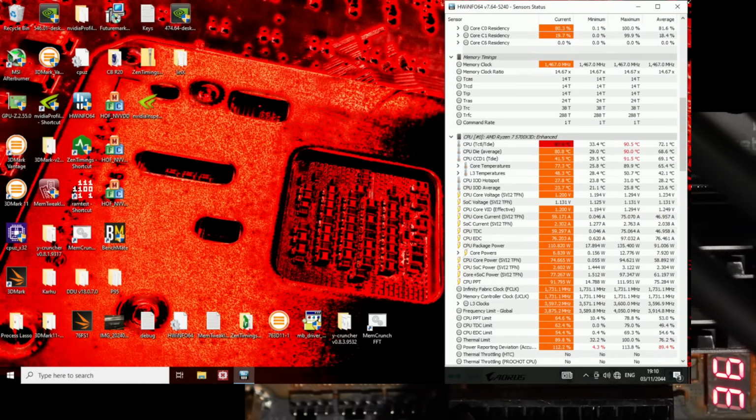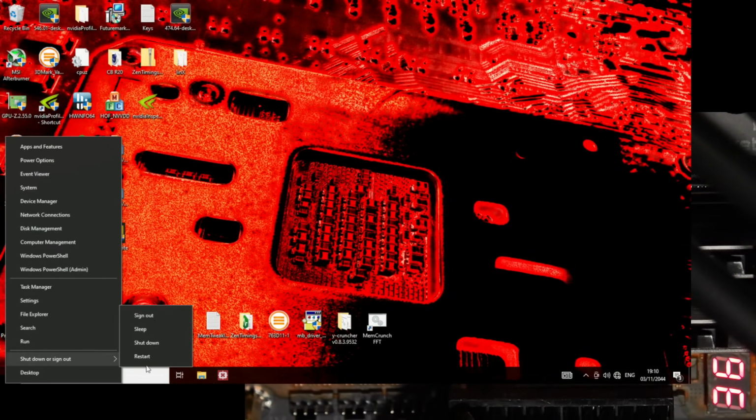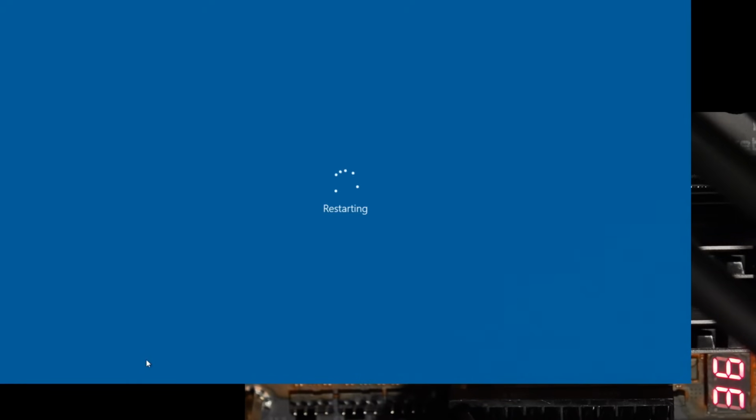But yeah, it just bugs me that this has to be so janky. At least on AM5, you do have ECLK, and the ECLK doesn't solve the boost algorithm fighting you, unfortunately. For whatever reason, the 7800X3D has fewer issues with ECLK or BCLK overclocking than the 5700X3D. But the main thing the ECLK solves is that you don't have to drop your PCIe speed and your memory doesn't get weird and all that kind of thing.